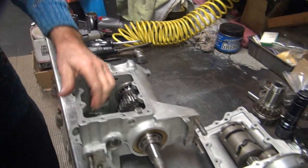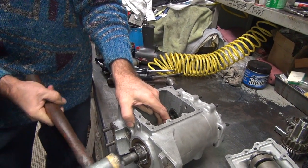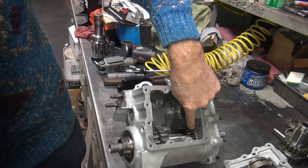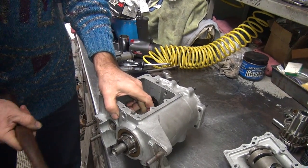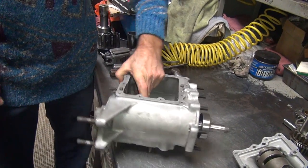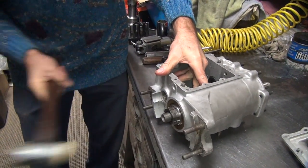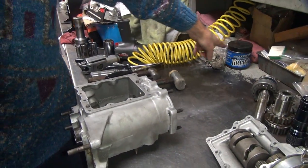Okay, now once that's all the way off, now you hold on the third gear, and it goes into that bar. Some of the gears are smaller than the races, some are bigger. The earlier trannies, it's bigger and you can't knock it out, but this one you can. Knocking out that race right there. You must have aimed it for that, not that.